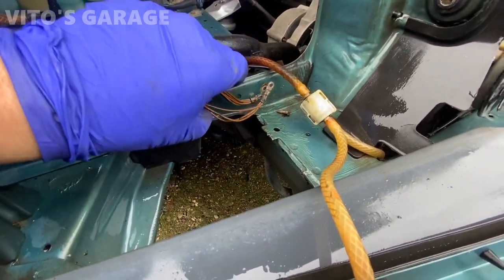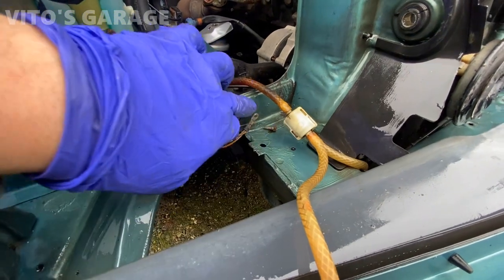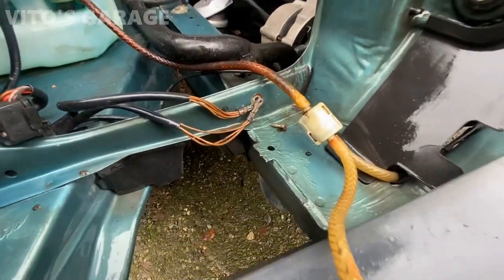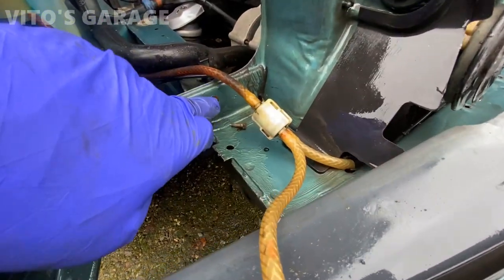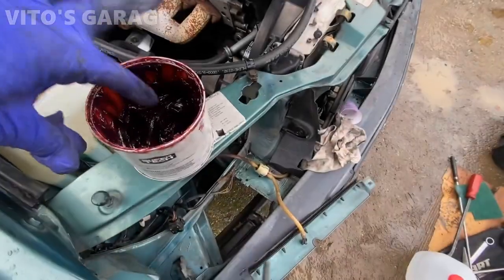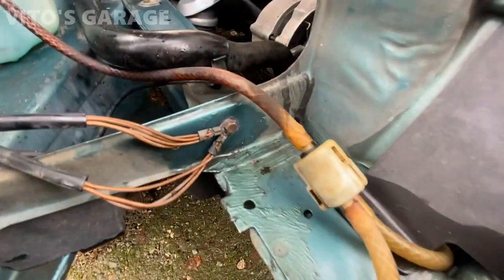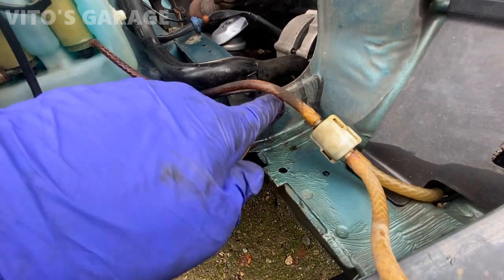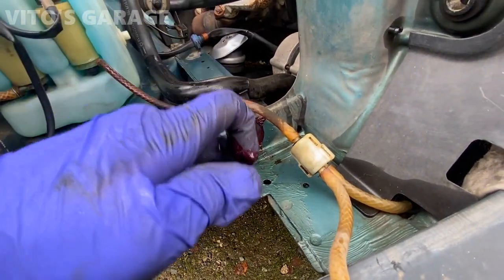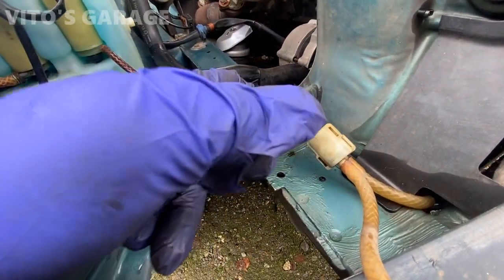So while I'm here, I'm going to service this ground point. I just want to sand it down, reinstall this assembly, and put grease on top — that way it's not going to rust anymore. Good idea while I'm here; there's some corrosion on that ground. As you can see, this is all cleaned up. I'm just going to add this grease on top. That's not going to cause any issues with the ground — I just mainly want to protect it from rust.